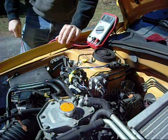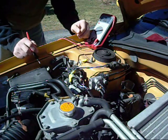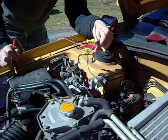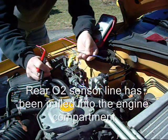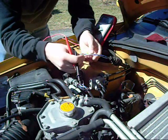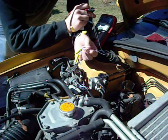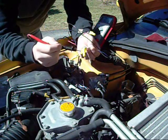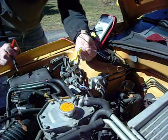We're here on a sunny New Hampshire morning with the beautiful sound of a turbo diesel tractor in the background. I'm going to talk a little bit about how to install an O2 sensor simulator. What I've done is I've pulled the O2 sensor simulator lines from a 2003 WRX up into the engine compartment. There are four wires here — two black wires which correspond to the heater on the sensor, and then there's a blue signal and a white ground reference wire. I've got them capped off so that when you're testing stuff out, you don't make any shorts or have any problems.